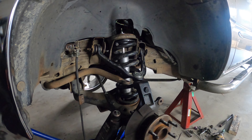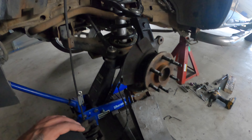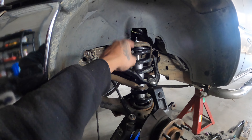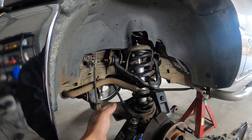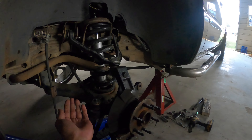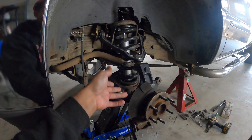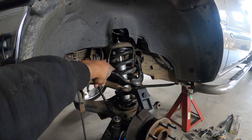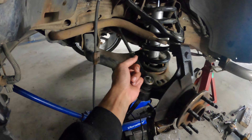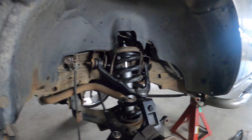These got to be the most sketchiest kits I can ever think of in my life. I got two jacks up under here, both pushing this spindle and everything up. In order to get that little level spacer in there, I had to basically have the control arm flat in front of the truck, then hoop it up so I can get the jack up under it and push it all the way up. I had to take the shock and compress it all the way down with some zip ties just to get it in there, because it was hitting on the back of the spring. Not too sure how this is going to turn out.